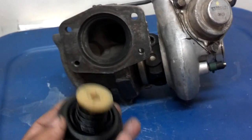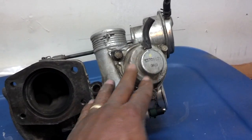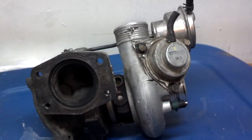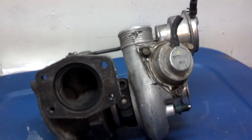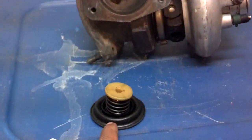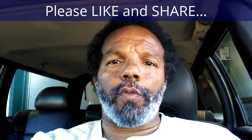To overview: you have a bypass or blow-off valve. If that diaphragm gets torn, it'll stop you from building the proper pressure in your turbo system, making it less efficient than designed. So if you're experiencing low boost pressure, you probably have a torn diaphragm in the back of your turbo.